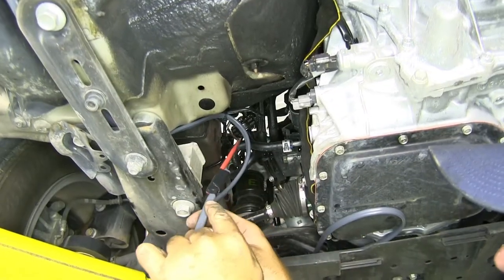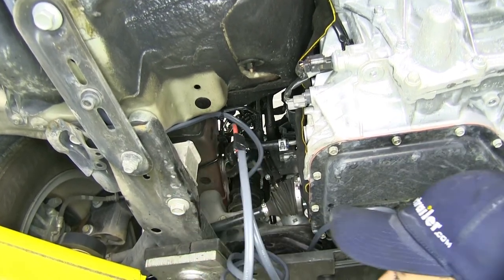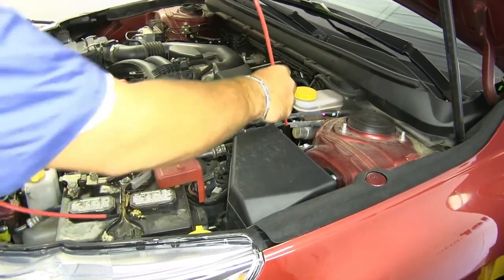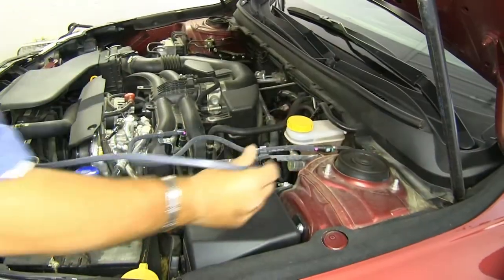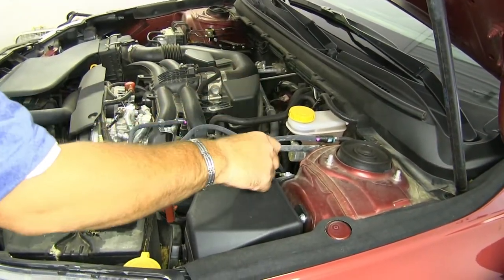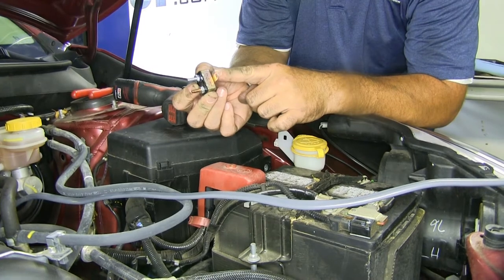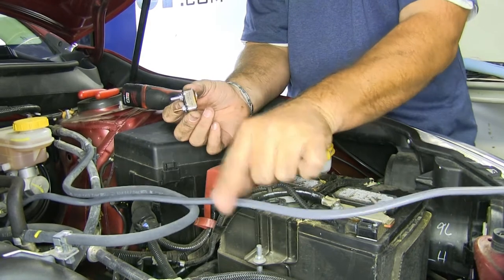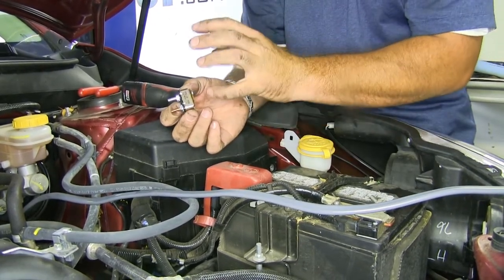I took the other end and put some electrical tape on it. I'll go up to the top and pull it up so it'll follow that line. Now we can just pull our airline tube up. It'd be a good idea to double check down there once you get this pulled up to make sure you're not snagged on anything. You're going to have a 40-amp and a 20-30 amp breaker. The 40-amp is for your black wire that's coming out of the wires from the back — it goes straight to your 7-pole and 4-pole.